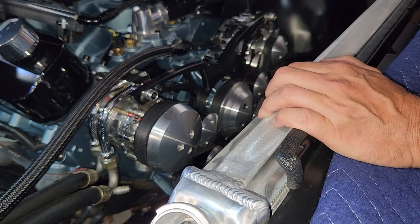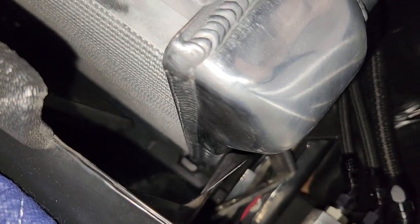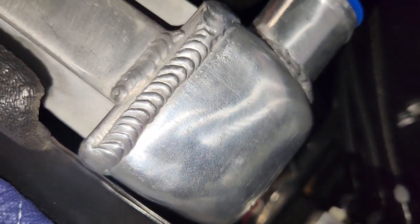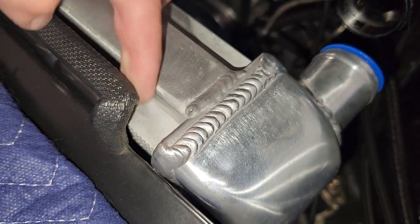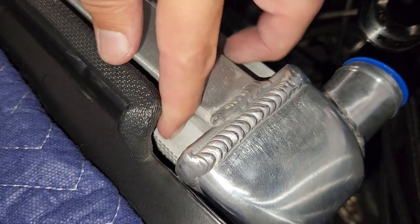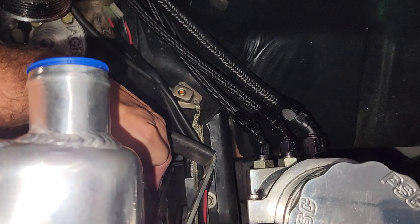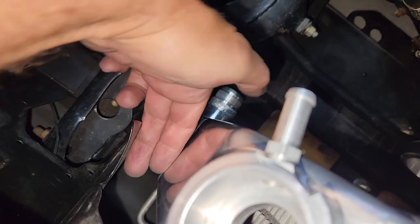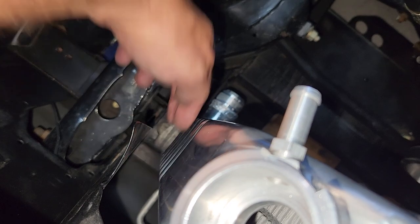Like a glove. The radiator is not fully seated, but you can see the rubber support right on the edge of the tank — it's also on the tank on the other side. You want to snug it up as close as you can. This is where we have to get creative, because most of us have a different radiator support and you might have to trim it. I trimmed this one to fit the Be Cool radiator. There's a tiny gap that runs the length — I'll monitor that, especially because air can bypass the radiator. We talked about shrouds before.